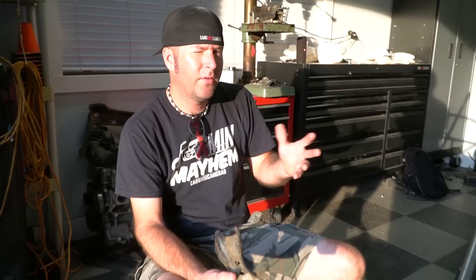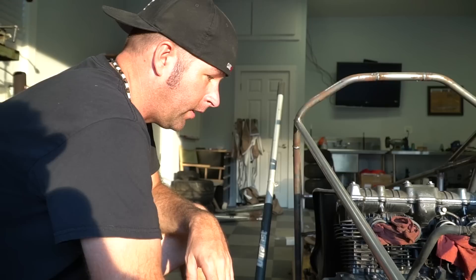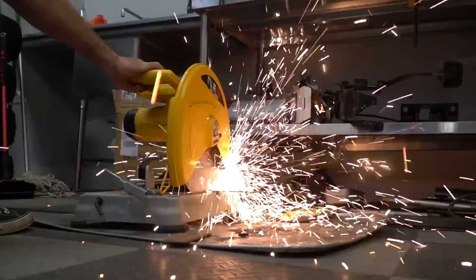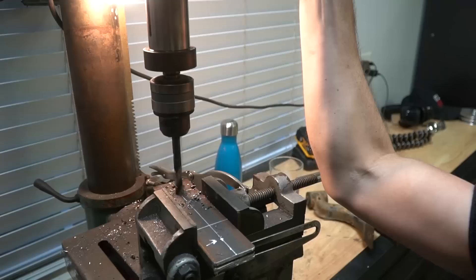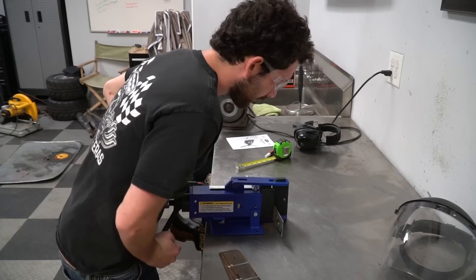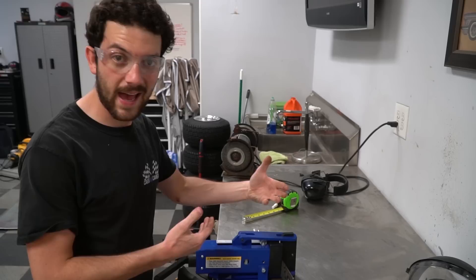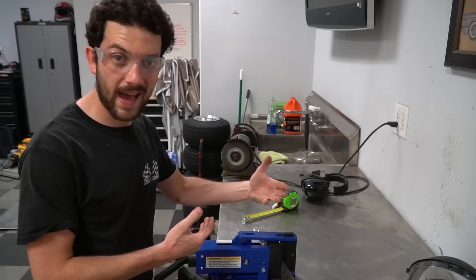Major updates I will make videos of though, like when the actual paint is on it. Are you fine with us reusing the upper control arm and just modifying it? I was thinking originally we'd make new ones but it's here, it's not broken — don't fix it. We can put it together and use it, and if we don't like it we can always build one using this as a template. We're only using one-eighth inch thick flat bar for these tabs and we really think it's going to be fine because it's the same thickness or a little bit thicker than the mounts on the Miata, and this thing weighs less than a third of a Miata with a driver.